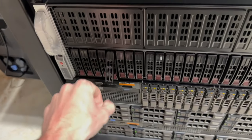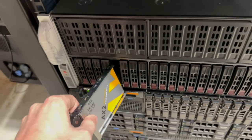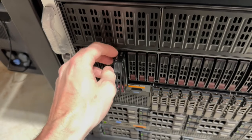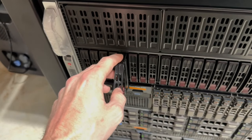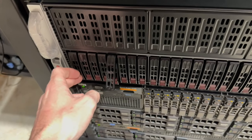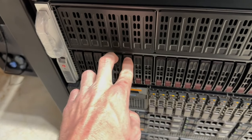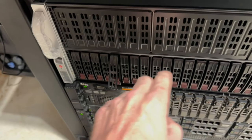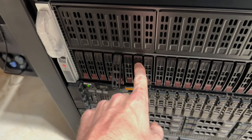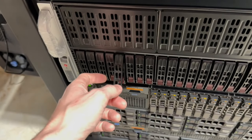And then for these four, you can have up to an eight disk array, or sorry, up to a six disk array with the SATA controller. So anyway, what I did is I moved these two over to the SATA controller, or the drive bays that will allow me to use the SATA controller. So it's a subtle thing, it's a simple thing, but it actually does make a difference. So basically, since I'm only planning on these four being in a RAID 5, and these two are gonna be in RAID 1, I just move these over, and then it gives me four other, so these two plus two I could possibly put in internally to give me another four disk, you know, RAID setup of some kind. You know, I could also replace this later possibly with a six disk setup, but anyway, this is what works best for me.